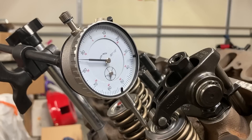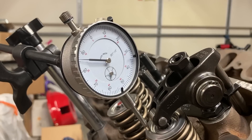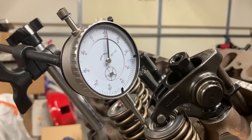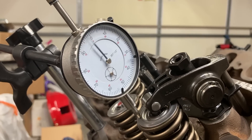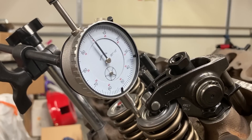So our geometry probably is not correct, but we do have plenty of space between the pushrod and the rocker arm body, which is really good. I'm going to get this back to zero and take it apart to look at the pattern on the valve tip.